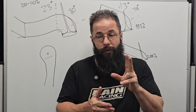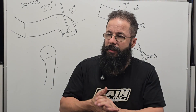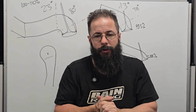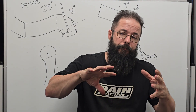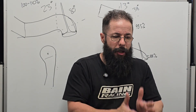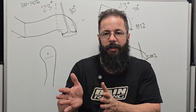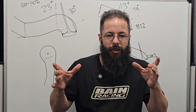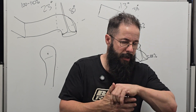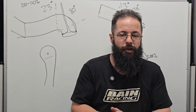The Audi we're doing is a dual-flow/DFI head, but this build will be a deletion of the direct injector, so it'll be straight wet-flow. They also have breaker plates in there. Be really careful how you take information and apply it to your project — some rules are specific to a type of racing. In a restricted class, you might actually shrink the valves, put in smaller seats and throats, maybe 85-86% on the throat. It all comes down to what you're actually doing.